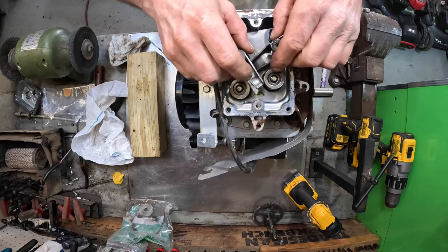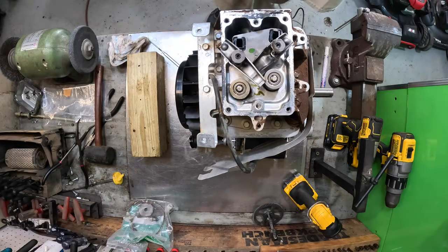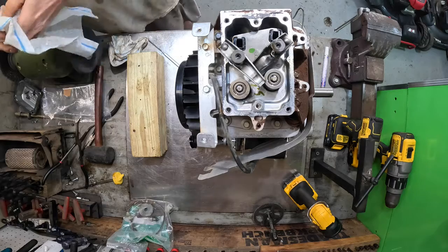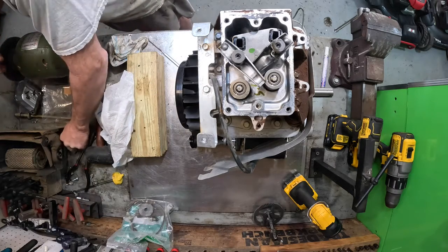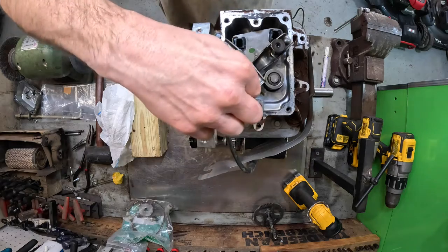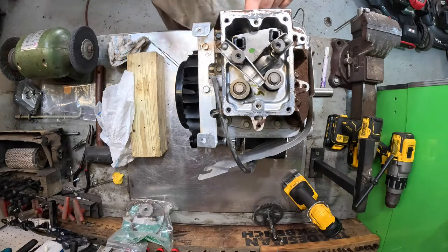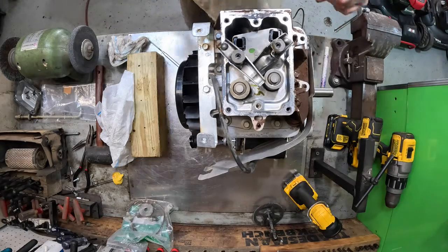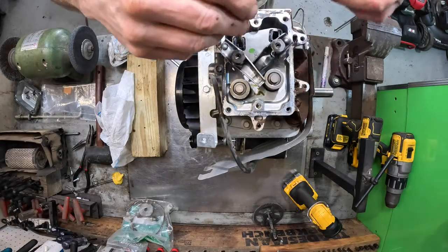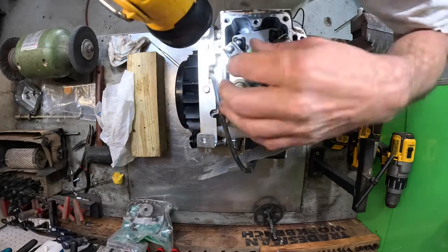Now we will put the valve push rods back in it, set the valves, and we ought to be good. Don't forget these little doohickeys. Right there, right there. Let's see, still what goes on the exhaust. Here's the exhaust right there. And then the intake is over there. Nope, that wasn't it. This is the intake and that's the exhaust. And it is going right that direction there. This is the stainless steel for the exhaust side. Make sure it lands on that lifter, just like that.